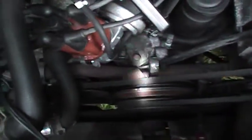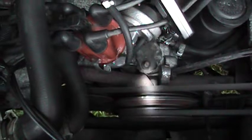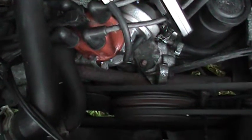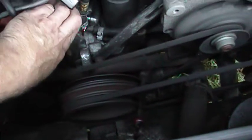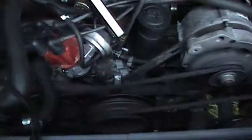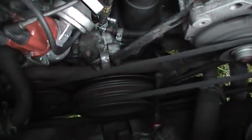Let's see where the timing marks line up — they're way over. That's just telling me the timing is too advanced. I'm going to believe the timing light and not the vacuum gauge. Then I'm going to tone it down a hair to get those marks at the seam again. I'm going to advance it — I can't do all three, but trust me that the centrifugal advance does move it around when I rev it.